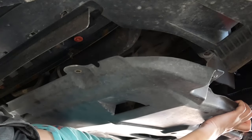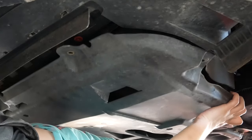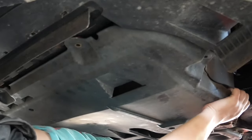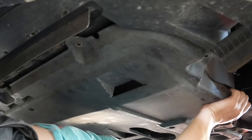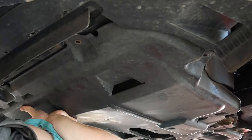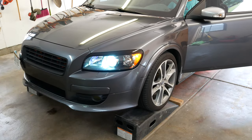Once you've filled it up with oil, start the vehicle to make sure there are no leaks and check underneath. When you're done making sure everything looks good, throw the skid plate or belly pan back on — it slides and clips into place at the back, and once it's lined up you can drop the screws back in to hold it in place. Time to pull her off the ramp because this job is done.